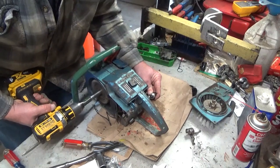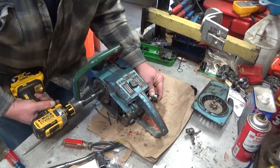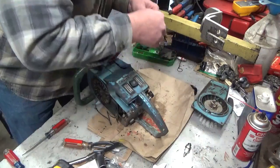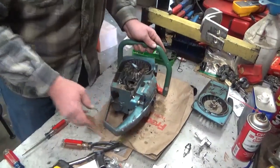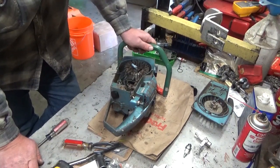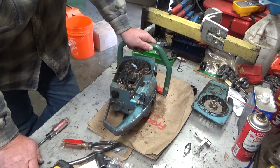Fire in the plug. Okay. So it'll fire the plug, but only once in a while will it jump a 1/4 inch gap. I'm going to assume that this coil actually isn't any good, or that it's weak on its way out the door. And a coil that struggles to jump the gap when it's cold like this, when it gets hot, it's probably not going to be worth a diddly dog shit.